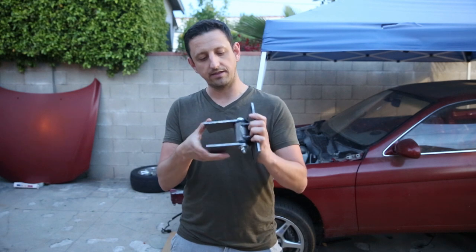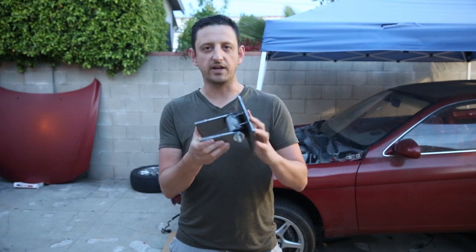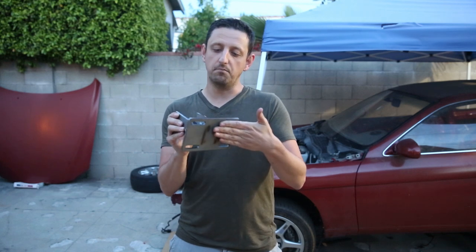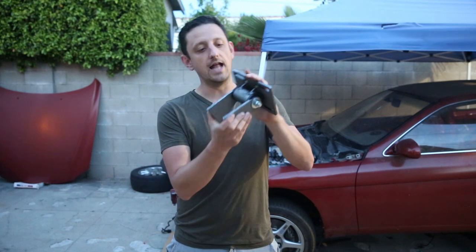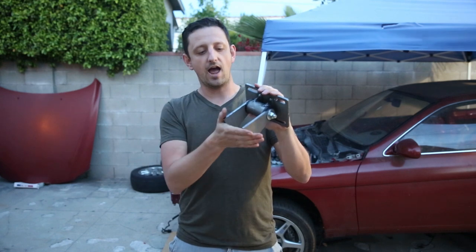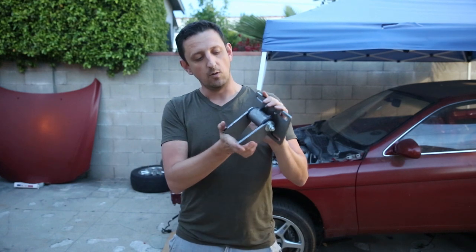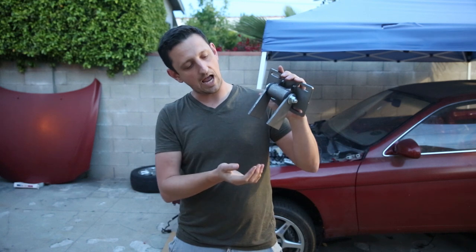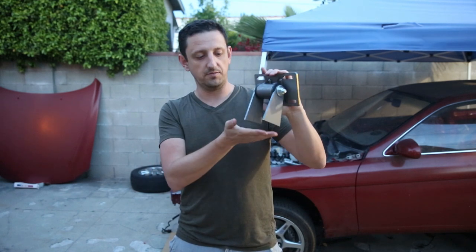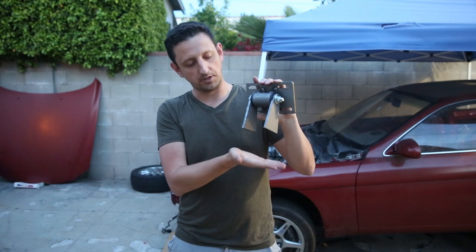This time though, I'm cheating a little bit because I went on eBay and got this mount. I think it was like $80 shipped for the pair. So this already has a slotted mount face for the actual engine block, and then it has an isolator already built in here and tabs ready to go. So my plan will be just to extend these tabs because they're about 2 inches too short for the actual engine bay to go down to where I need it to go in the cross member.